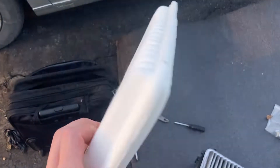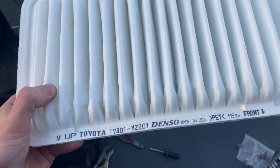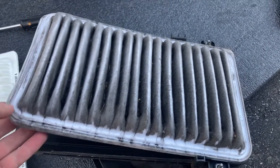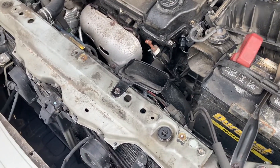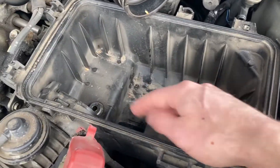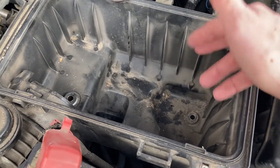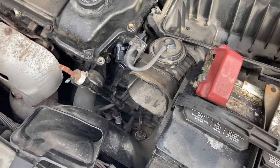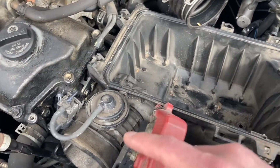I want to show you now that I'm replacing the air filter — this is what a new filter looks like. You can obviously tell there's a big difference between this and this, so this definitely helps with fuel economy and keeping the car running longer. Putting this stuff back together the same way I took it apart — put these screws in the air box. Make sure to clean out your air box well so that your new filter goes into a clean space. Give the EVAP flapper a little wipe-clean — you don't have to go crazy, don't put water in there, just scrape it off so the flap moves freely.